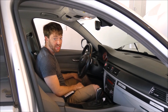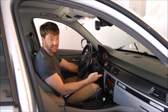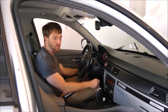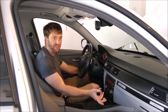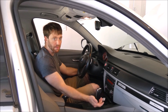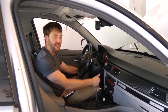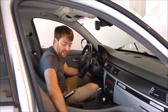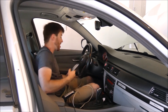I think I may need an injector — I get a little rough idle for about two seconds when I first start the car, but as you can see it's already fixing itself. It's just really cold start behavior and then it smooths right out. I think I have an injector that's dribbling fuel on the spark plug. I do have a cylinder 6 misfire index of 7, so very likely. But it seems we've had success with the flash.